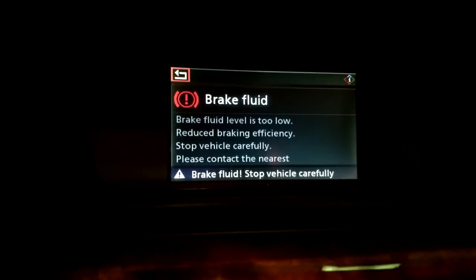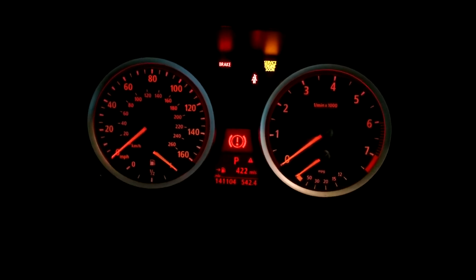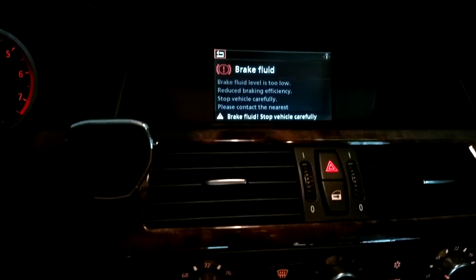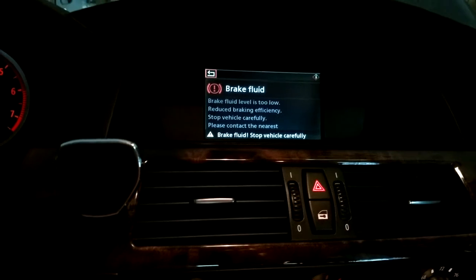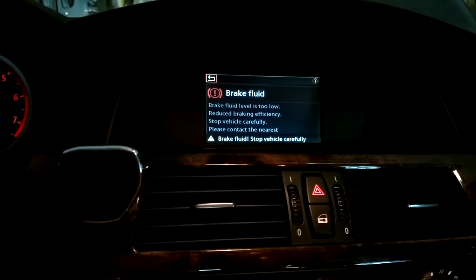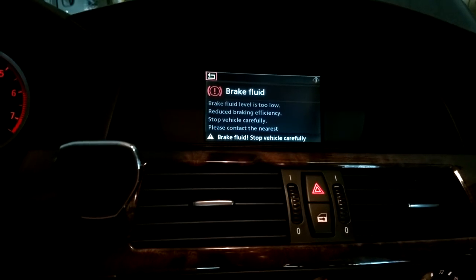Or you have a leak. In my case, it ended up that I had a brake fluid leak. I could tell because I topped off the fluid and pressed the brake, and it would slowly go to the floor, which told me fluid was actually being pumped out of the system. I had to top the reservoir off a couple times while pumping, because there was no fluid coming out anywhere until I'd put probably the better part of a pint through the system, and it started leaking out just ahead of the left rear tire. I'll show you why that is.